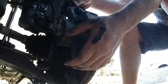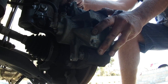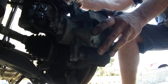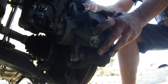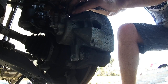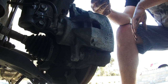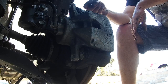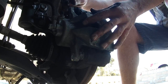The most important thing is that these pins here move freely. You can take them out, clean them off, and put new grease if you want. This is my own car — I don't find it necessary. But if I'm working on a customer's car, I always do that. It's just part of a brake job: take them out, clean them, put new grease, put them back in, make sure they move freely.